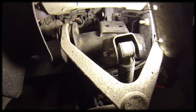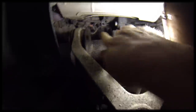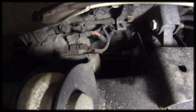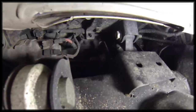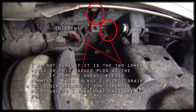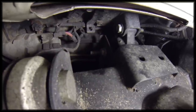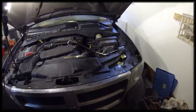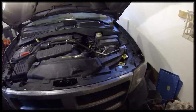Let me show you where the drain plugs are. This is the passenger's side — if you look in here, you'll see a couple of nuts. There's one right back in here — you see that collared nut kind of behind that red wire? And there's another similar-looking one right back behind the engine mount, screwing right into the engine block. Those are the coolant drain plugs, I believe. I think there's another set on the other side of the motor too. I decided not to take the engine drain plugs out — I wasn't sure 100% which ones they were, so I wasn't going to mess with it.